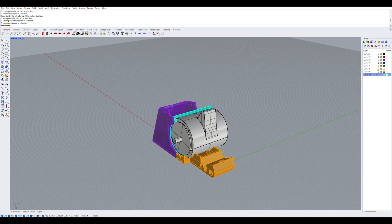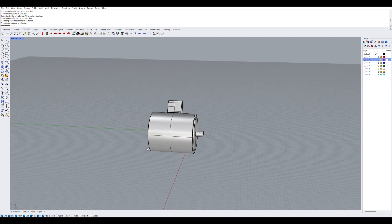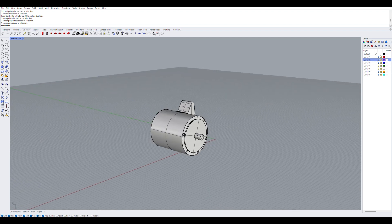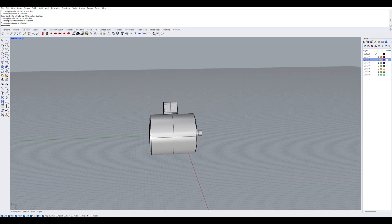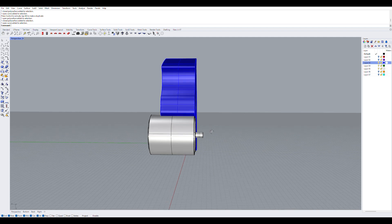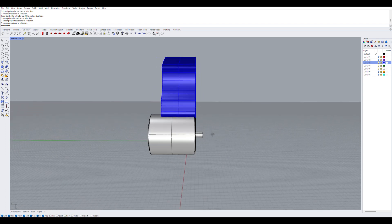The first layer I'll show you is the motor. So this is the QS120 motor — it's about eight inches long, just under five inches in diameter. Overall, it's probably the biggest electric motor you're going to get into a CL90 frame. This little motor mount that comes with the motor is flush along the inside of the right side of the frame, and that basically aligns the front sprocket perfectly with the rear sprocket with just a little bit of modification.